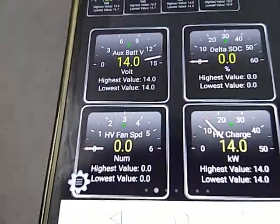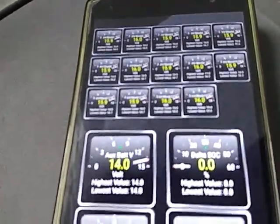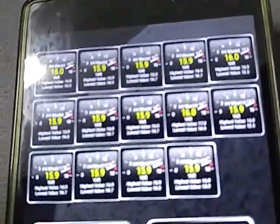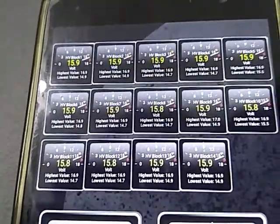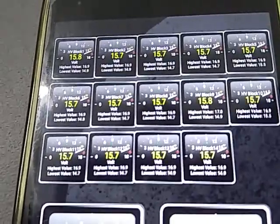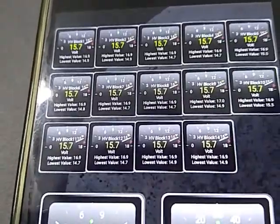Anyway, I've already changed the battery — it checks out perfect now. If anything turns out on this that I don't like, I'll let you know. But if you're worried about your battery on a Prius, try this out — it's not a lot of money and you'll know exactly how all your cells and your battery are doing. All the cells are supposed to be equal — they call it balanced — all the voltages supposed to be pretty close to the same. Mine's down about a volt with 124,000 miles on it, so I should be good for a while.